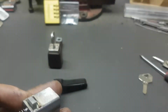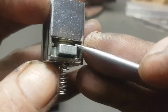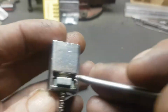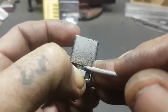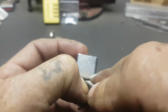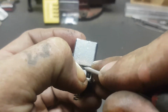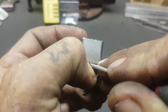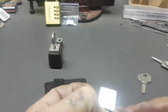What you'll find, a retainer wafer at the back there, you can see it, it's a wafer, that's got to be pushed down, and at the same time push the plug out. Just hold that latch tongue right down and depress that. And sometimes it's a bit awkward. Gotta get it just right. I'm doing this for the camera, which is bloody near impossible.